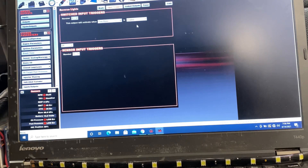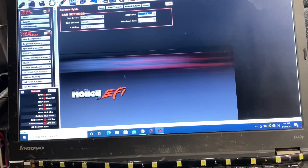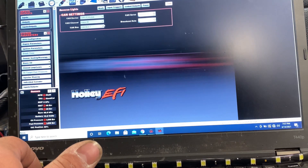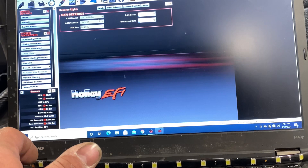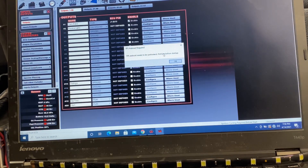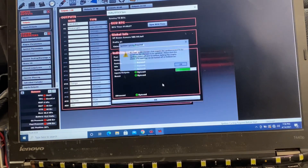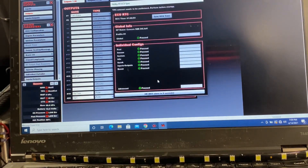So we need Holley to give it a ground to light it up when I press the trans brake button. The configuration is: I've got one switched input which is the trans brake, and when it's enabled we'll turn this output on. In the upper right this is where it differs a hair from a Dominator. You go to CAN, put in the serial number which is on the back of the box. Hertz is how quickly it sends information back and forth to the ECU — something trivial like this, one hertz is fine. If it was something like a timing retard that needs instant feedback it'd probably be 100 hertz, your max. CAN device is going to be a CAN input/output module. We're going to use output number one, and CAN bus number one. Link this to the car with the changes — the only thing that failed is input/outputs because that's all I changed. Send it to the ECU, then a quick ignition cycle and we're live.